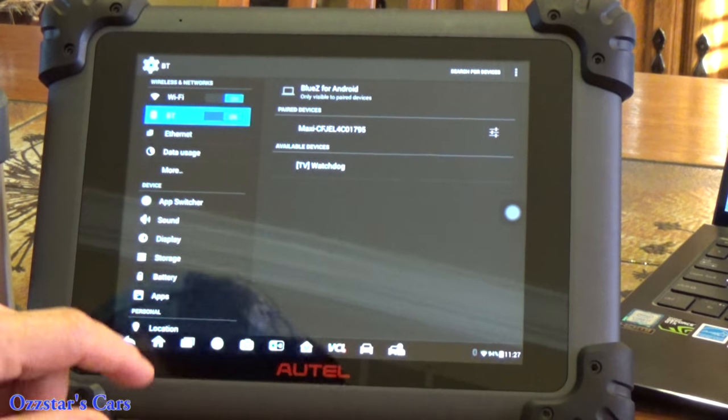If you have three or four Hyundais sitting there, a 48-hour pass would be a great deal. You would need this J-Box and your laptop for that programming. In the Hyundai or GM case, the scan tool tablet itself is not necessary for the actual programming — I know that sounds surprising. Also worth noting: the 906 or 908 — none of the MaxiSYS tools — will read OBD1 pre-1996 DLCs. You can't get live data or trouble codes from pre-96 vehicles with these tools.